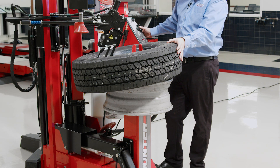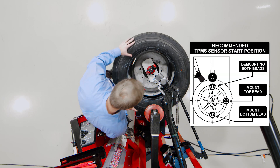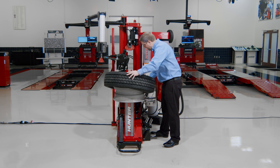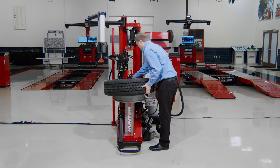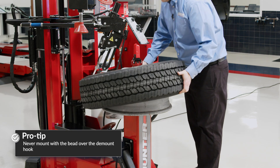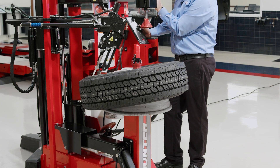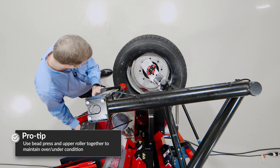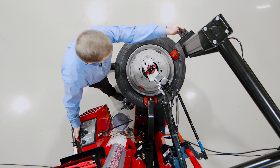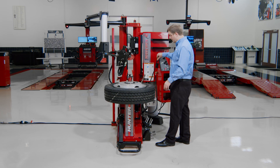I'll bring my mount head down and set my TPMS position. I lean into the machine and use that control console as kind of a traction point to get these really stiff bottom beads started. I can get my hook out of there if it's stuck — I definitely don't want to mount over that hook, so I want to make sure that's all the way up in the stowed position. Go ahead and mount. Fairly difficult tire — heavy duty tire and wheel assembly — done very easily.